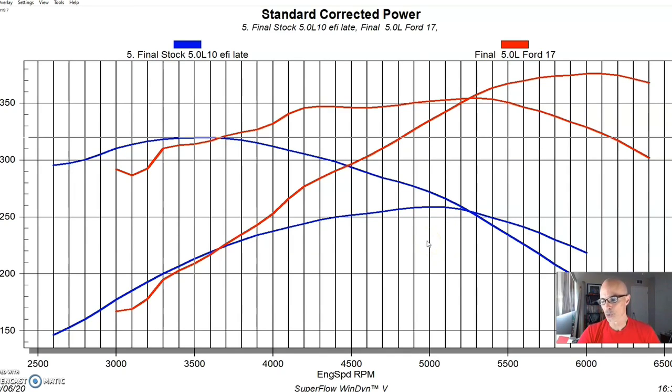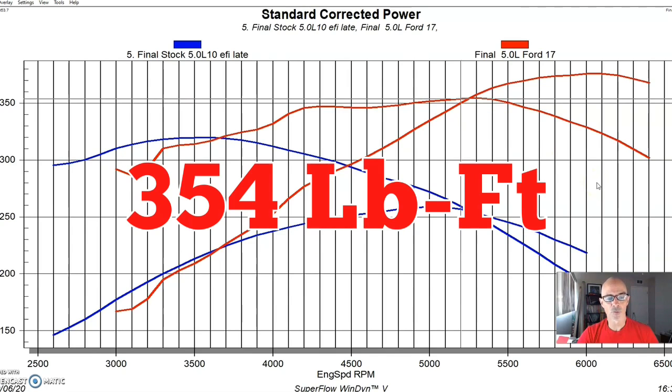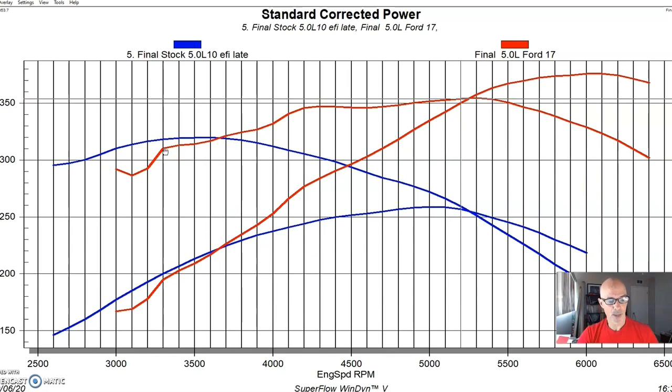I removed the TFSR combination because that short runner intake on a mild cam and twisted wedge heads just isn't a good choice - we're talking about something making peak power near 6000 RPM, and it doesn't have enough displacement or RPM to take advantage of what that short runner combination wants to do. Instead of making peak power near 5000 RPM, we're making peak power near 6000. Torque is up quite a bit - 376 horsepower peak, torque up at 354 foot-pounds. There was a slight loss below 3500 RPM, but when you do heads, cam and intake on a five-liter and get it revving cleanly to 6500 RPM, all of a sudden your Mustang is super fun to drive.